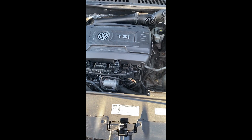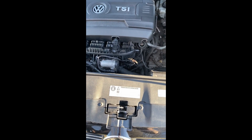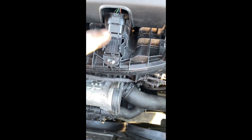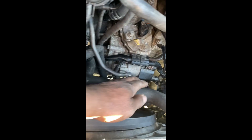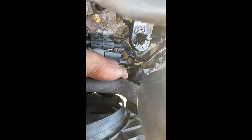I've got a 2017 Jetta with a G31 boost pressure sensor circuit low — which is this sensor right here, at the very bottom connected to the pipe. For whatever reason, they swapped this connector — G31 — with G71, which is this one right here. This one splits over here with a four-pin connector, and G31 is also a four-pin connector.